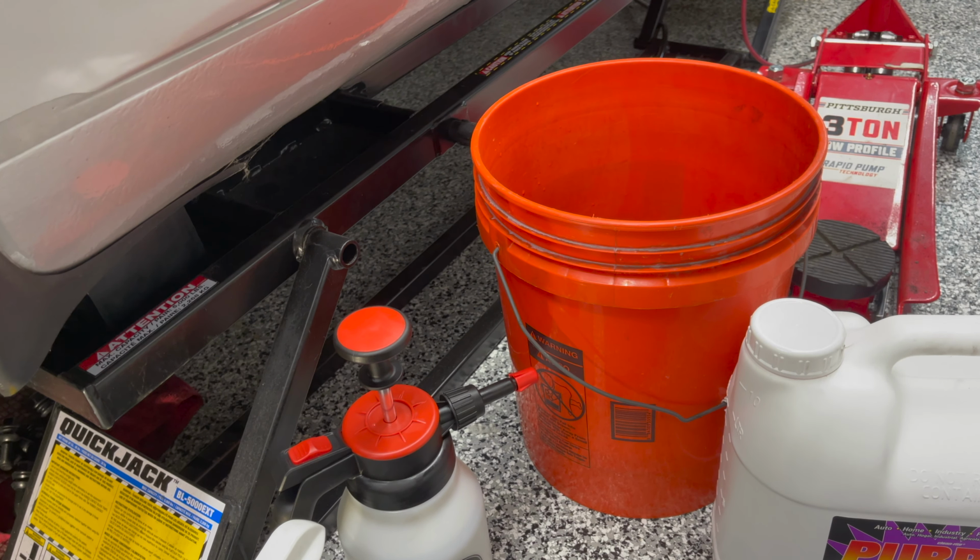The replacement parts, I'm using, like I've been telling you, the Koni Active Suspension. Really cool stuff. I can't wait to try it out. And it comes with the lower spring plate, which I'll show you how to put on because there's a specific way, as well as a washer cap that covers up the shock on the top, and a brand new nut, which is important for the cap. Tools. You'll need two spring compressors, as well as a 19 millimeter box and open end wrench, and a 21 millimeter. Well, it all depends on your spring compressor for this one. Mine's a Tecton, so it requires a 21.